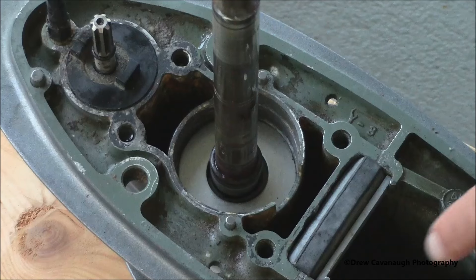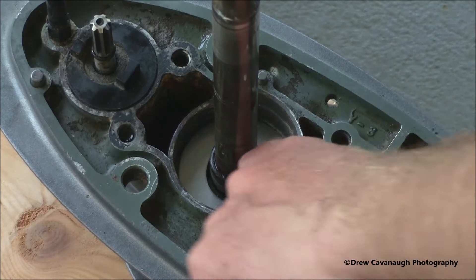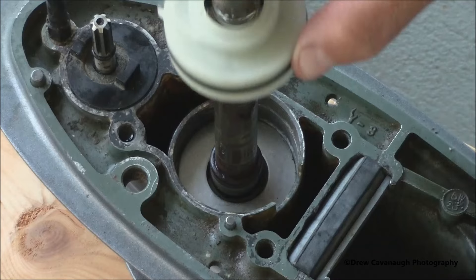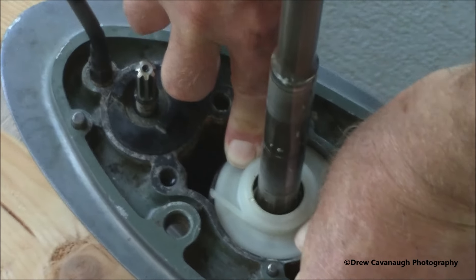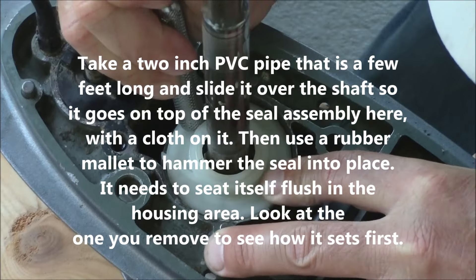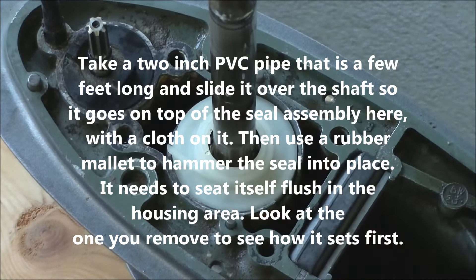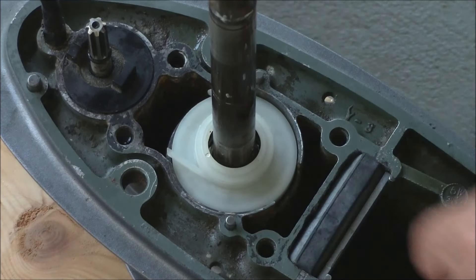Okay, we've got it out, got it cleaned, and replaced the damper seal and the damper seal ledge. Now we're going to put the lower housing seal back on — it's really simple. You can see I cleaned all that out in there with a steel brush and used a screwdriver to get all the corrosion off around the edges. We drop this down into here like this — push it down — just make sure it's seated. There you go. That's pressed in and I can see the seal's tight.